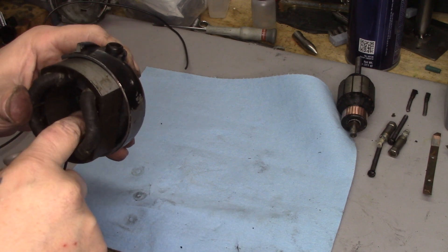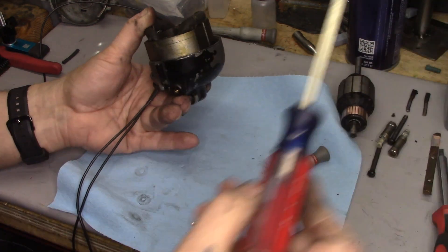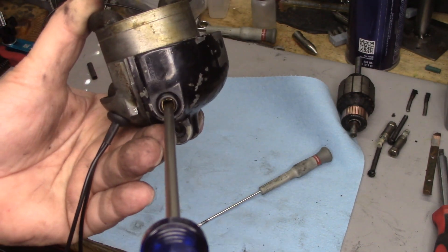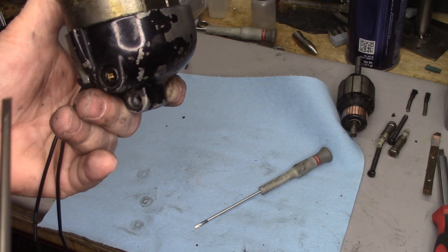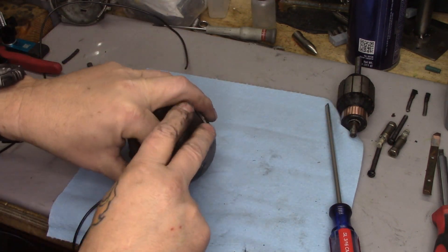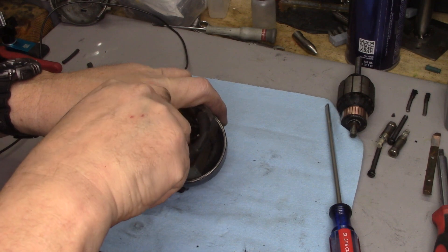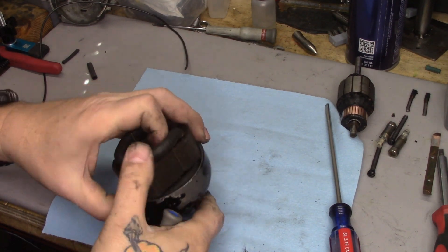Here's the tricky part — and you knew there was going to be a tricky part. I need to find a 3/16 inch screwdriver. What we need to do is rotate the brush holder itself so that it's square and perpendicular with the axis of rotation. Then we have to push this so it's coming slightly out, reach down inside, grab that screw, and just snug it. Don't go cranking on it — just snug it — because we're going to be going in there again and moving it some more.